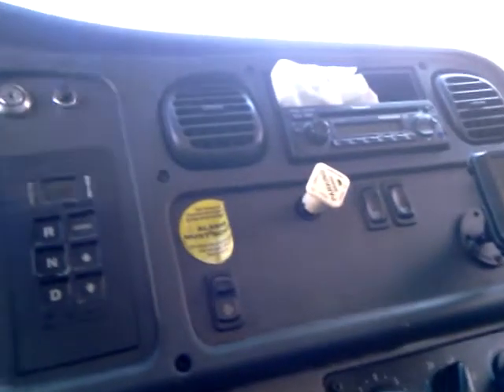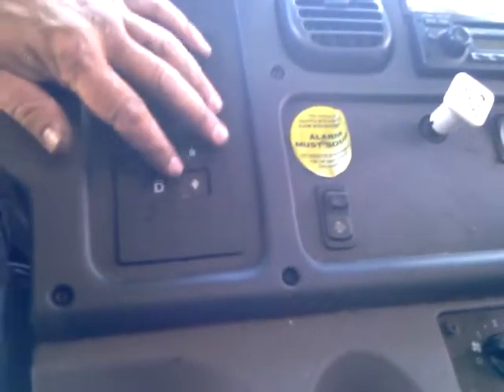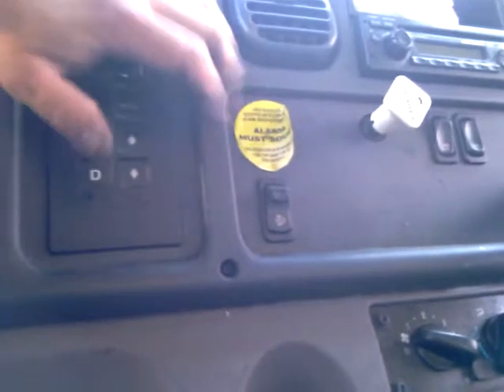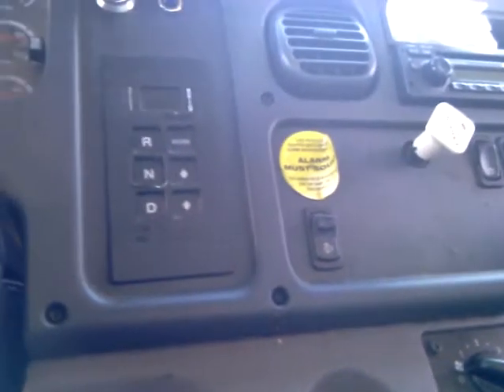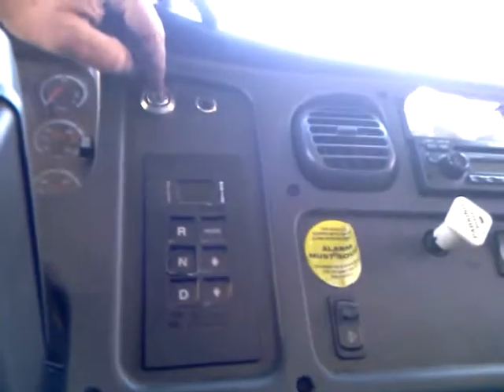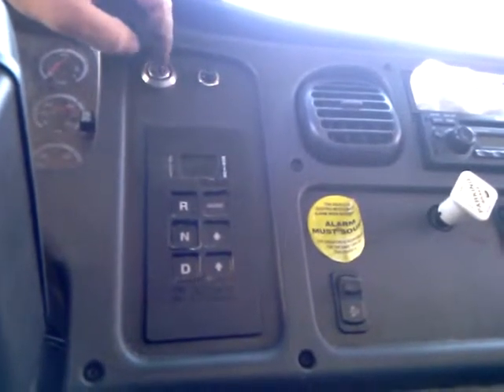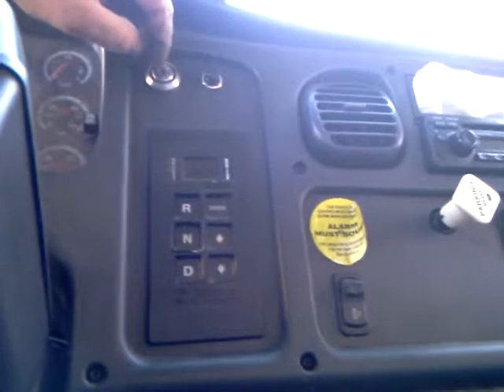Once this panel's off, you can take this panel off that this is in, and this panel off as well, where you can remove the old GPS system. We wired directly into their aftermarket starter master switch right here. Turn this key all the way on and you can get your true ignition and your true power from this harness. This is your button to start the truck.